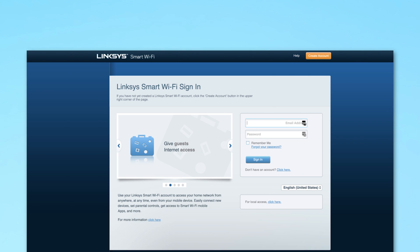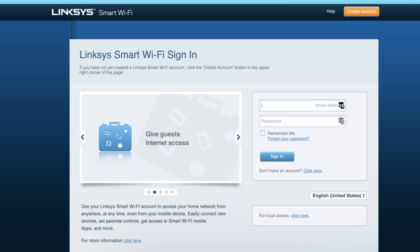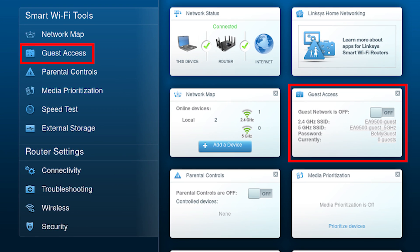Now, if it does have that feature, it's probably not going to be enabled by default. In any case, you're going to have to go to the router settings. The usual IP address for the router is going to be 192.168.1.1, but it might be a little bit different in some cases. Just Google the router model name and then 'default IP' and it should come up. Usually when you go to the router settings page, it's going to ask you to log in with the username and password. If you haven't changed this, it'll probably be a default — it might just be 'admin' as the username and password. Then once you're in the router settings, look around for Wi-Fi settings and then look to see if it does have a setting for guest Wi-Fi. If it does have the feature, you can probably look for the support pages that describe how to enable it and just follow that.